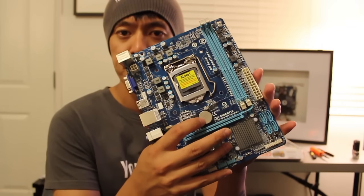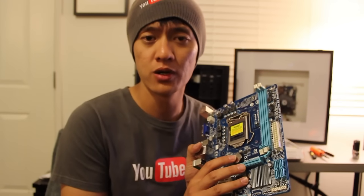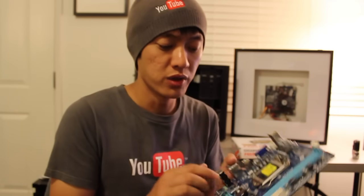So that's one type of scenario. Another type of scenario — see this battery right here? Sometimes, if the system's older or it's been unplugged for a really long time, this battery is supposed to keep things like date, time, and some settings hardcoded into the BIOS — like how your CPU is going to run or how your RAM is going to run. Maybe that battery isn't functioning properly, or it's just been unplugged too long and it's not holding a charge. Or maybe one little setting got reset and then your system isn't able to boot. If nothing's able to boot, or the machine turns on but there's no readout or screen — you hear the power supply kick on — it could be that you need a fresh new battery and to reset the BIOS with the jumper setting.